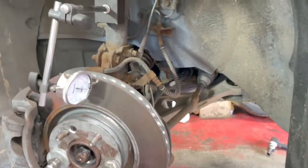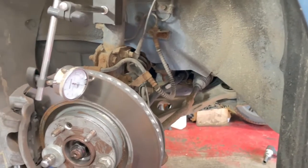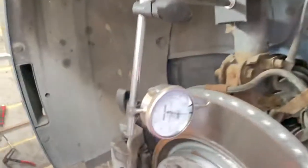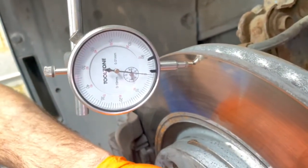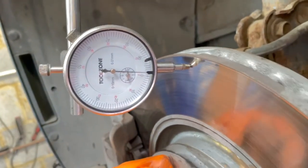What we have done is taken the wheels off and inspected them. Nothing was visible on the disc on both sides — the vibration was definitely coming from the front. We then put a gauge on and measured the discs to check if they are true, and we want to show you here what we have found.